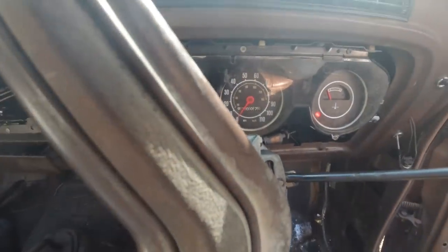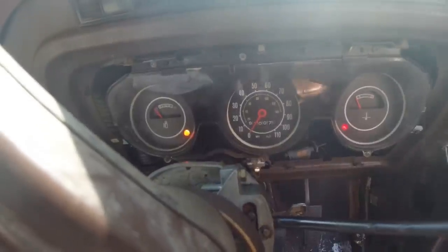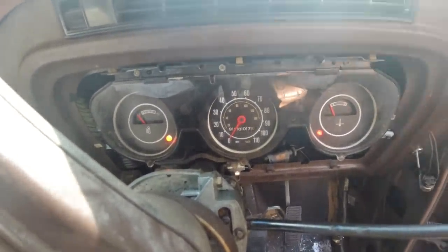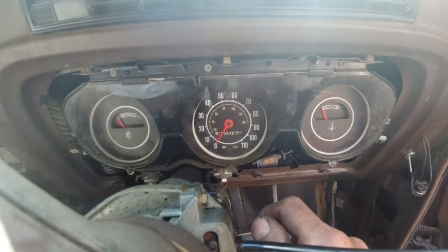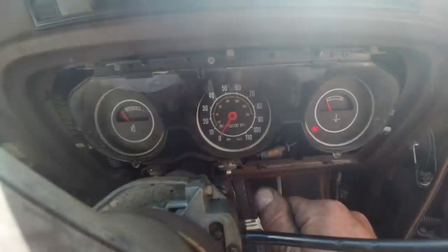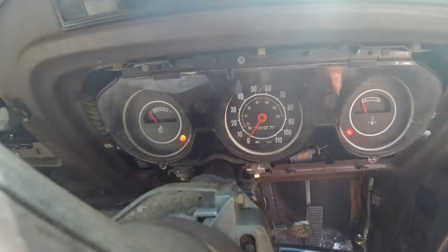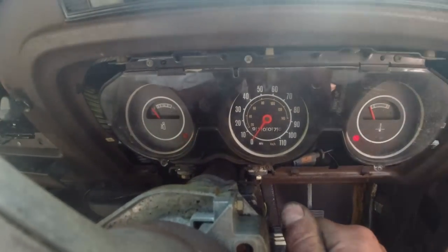No, I don't think the fuel gauge is moving. I think it might be knackered, that fuel gauge. Or there might be a bad connector on the tank plug, but something's not right. They're notorious. I did squeeze the plugs and make sure it was on. They're notorious, but there's no movement on that. Don't think anyway. Oil pressure light goes out. That's a good sign. Good oil pressure's coming off straight away there.